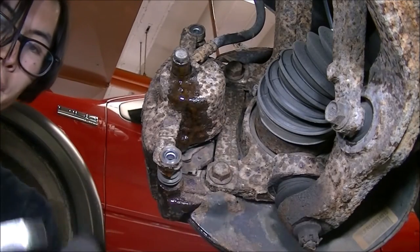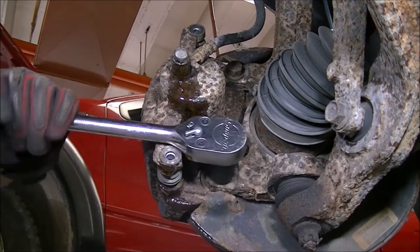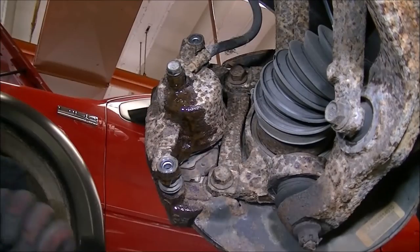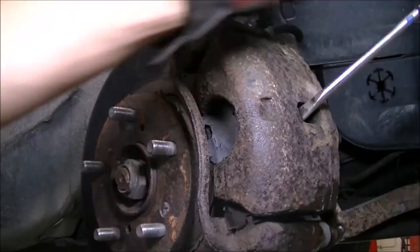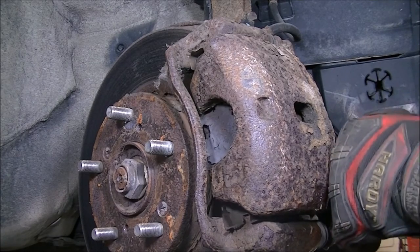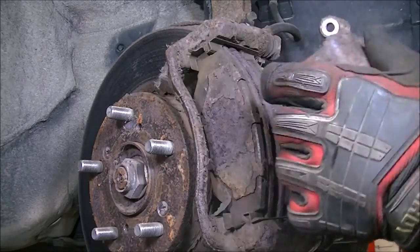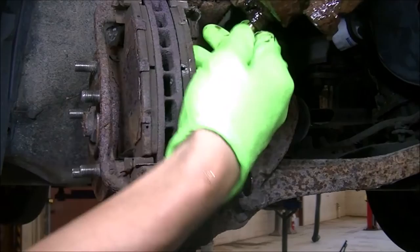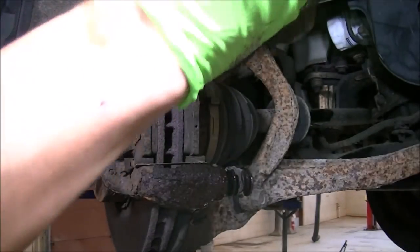Using a 17-millimeter with a long ratchet, I'm going to loosen the upper bolt holding the caliper bracket in place. I'll loosen it the rest of the way with my normal 3/8-inch drive ratchet. I'll take a flathead screwdriver and jam it in here. Making sure this banjo bolt comes free — I'm going to be reusing it. That should give me enough to pop this up and out. There goes the banjo, the crush washer, and there's our caliper.